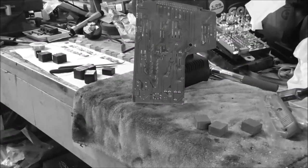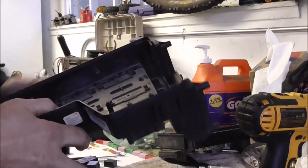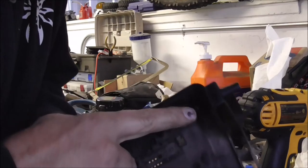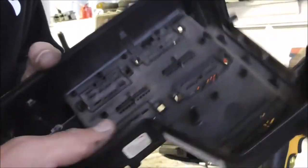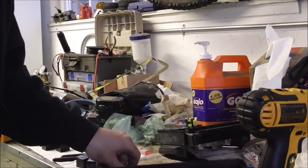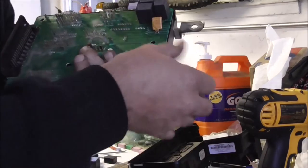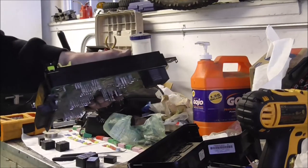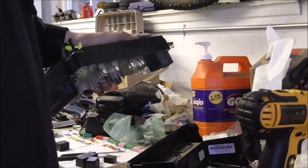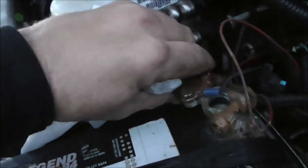Those are the little tabs I broke off. I went ahead and drilled a hole and grabbed a couple of small screws from my RC stuff, so we'll go ahead and put the lid on this. Everything slid back in — new relays, everything slid back in. I'll put the fuses back in and reinstall this in the truck. Just reverse order putting it back. It's in. Got some wires here — someone added those for the bully dog chip — but everything's in. Now I've got to hook up the battery.